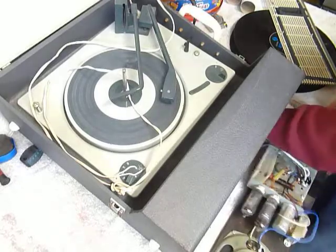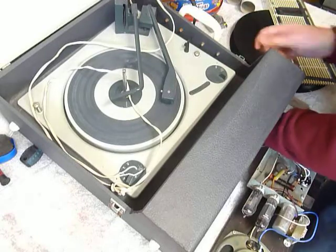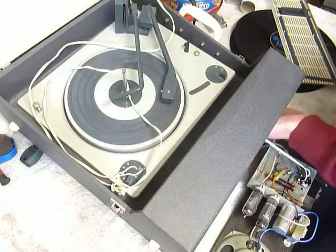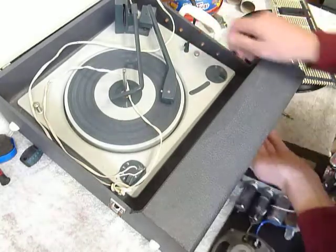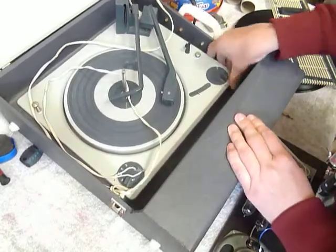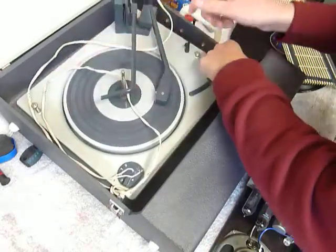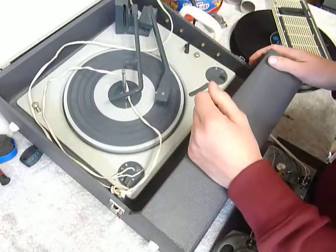If you've got slim hands, you might be able to just reach the nuts underneath. Hold the nut with your finger this side and unscrew the screw on that side like so. But if you can't, if the transit screws are down like so, just flick up the clip 90 degrees on the end and the deck then lifts out so you've got more space. If you do the same with that one and put your hand under it, the deck lifts out completely so you've got full access to the inside, no problem at all.